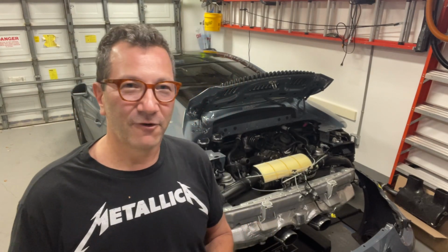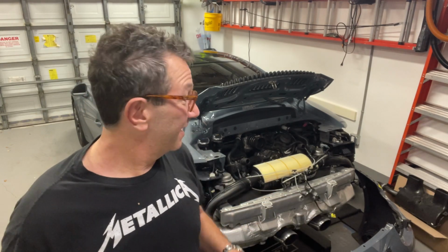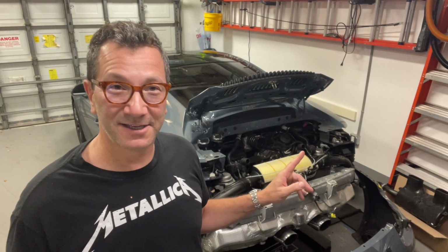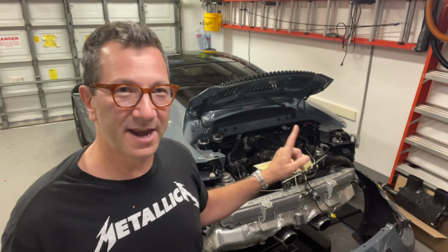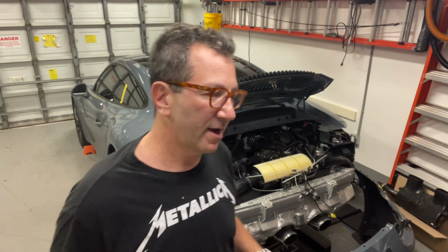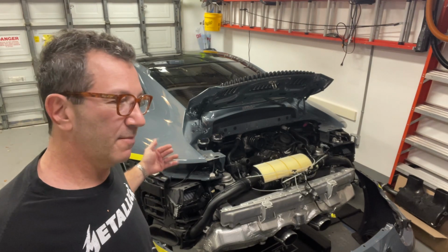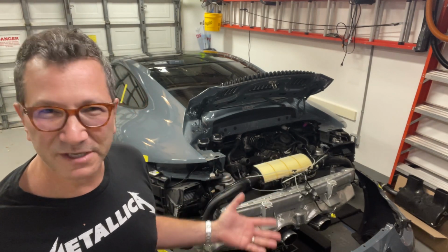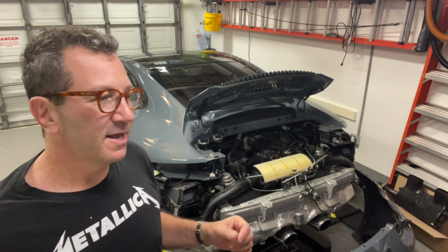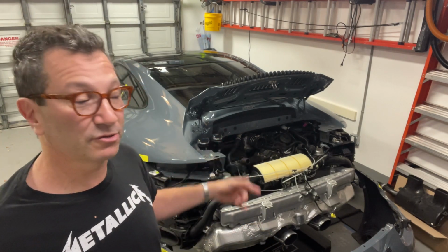So for all you people out there with a 991.2 Carrera, get ready, because this is hopefully going to be a video that helps you. The things that made it more difficult were the things that caught me by surprise. Number one, there were additional screws behind the wheel well. That took me a little bit to figure out, because I couldn't work out why the bumper wouldn't come off. There were actually two additional screws back there.